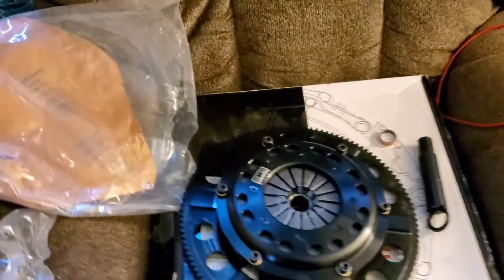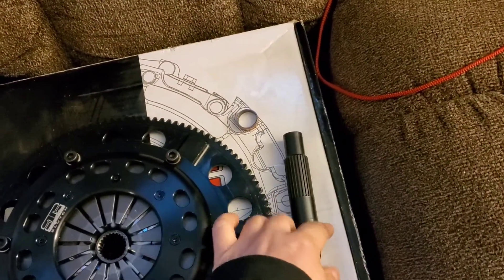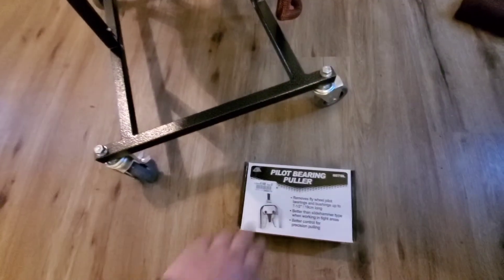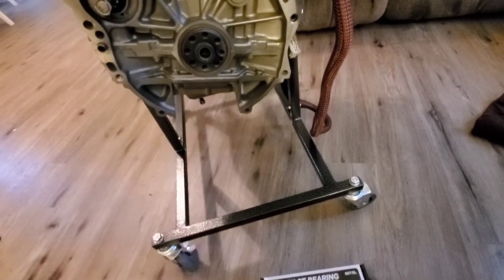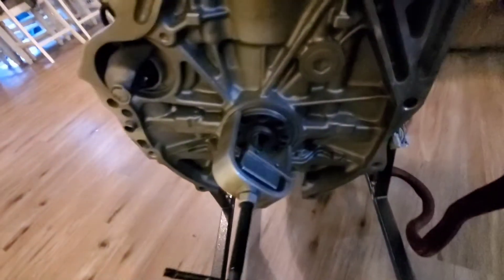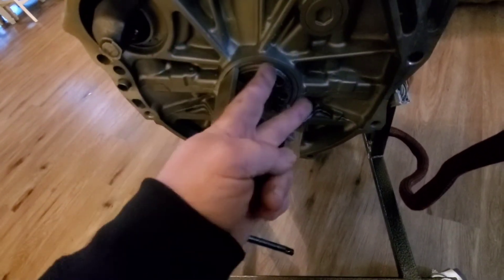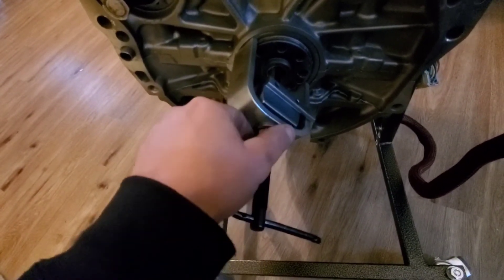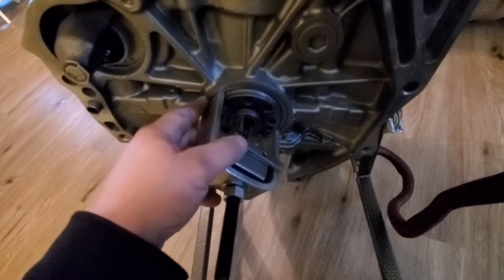I am running a stock transmission, and that's probably the first thing that goes. We'll rebuild that if it ever goes that way. This kit comes with a throw-out bearing, a guider, and a pilot bearing. Right now I've got to pull this pilot bearing out — I got this tool from AutoZone for 25 bucks. Basically you put these in, start turning this out, and that makes the two little arms spread out. Then you spin this and it makes the bearing pop out.